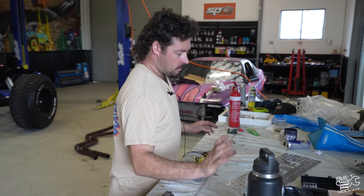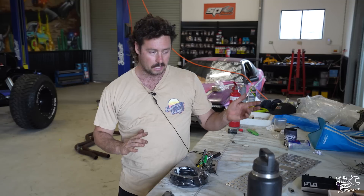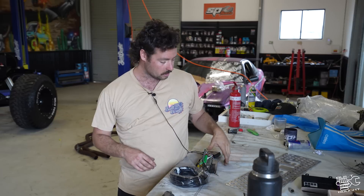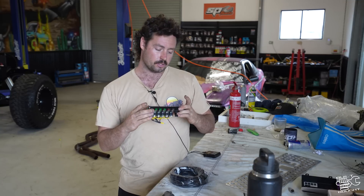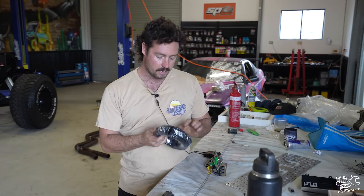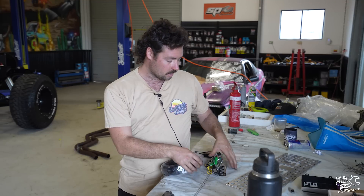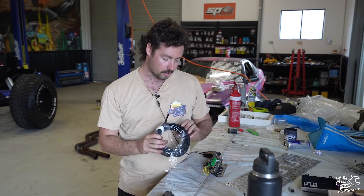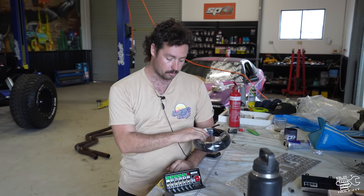The fuse box is wired now. Here's a little trick I've learned over the years to keep things simple and clean: when you want to run an external switchboard or a roof console with a bunch of rocker switches, these are generally only used for signals which send a positive or negative signal to a relay - they don't carry a lot of current. A good clean way to do that is use trailer wire. You can get it from any automotive store - usually comes in a seven pin bunch, one single black cable that runs with seven smaller cables inside in all different colors. You can run those seven cables to all the signals from your switches and then run them down to the relay. Pre-wire it up, match the colors down to the relays, and all you run is one cable.